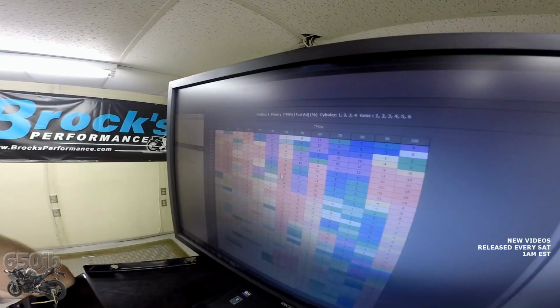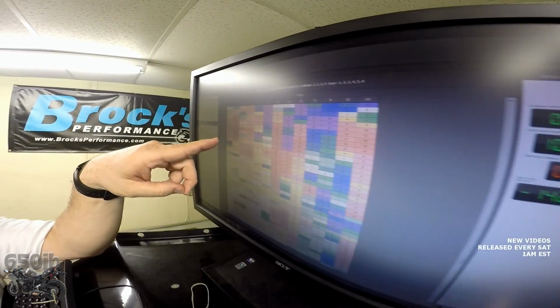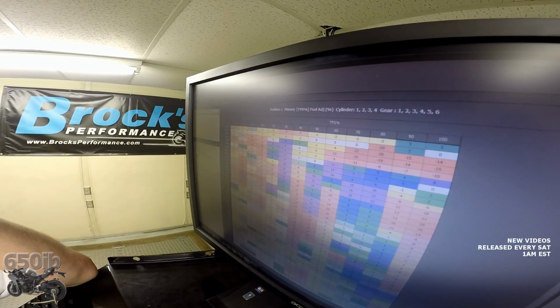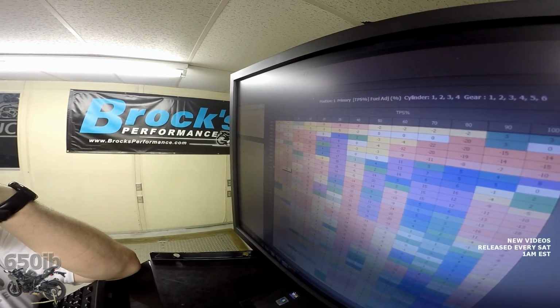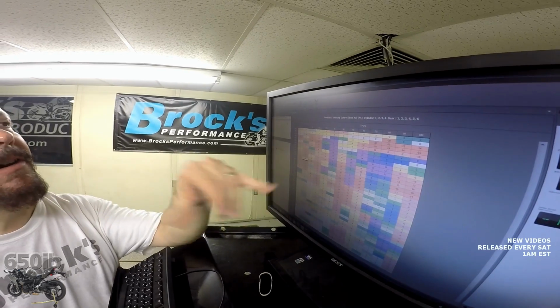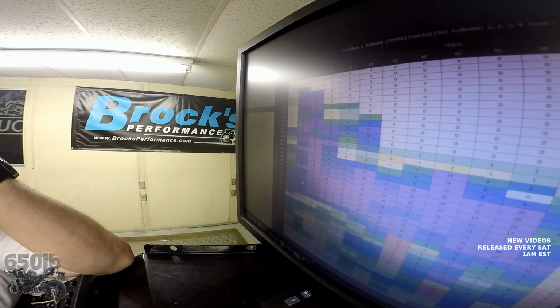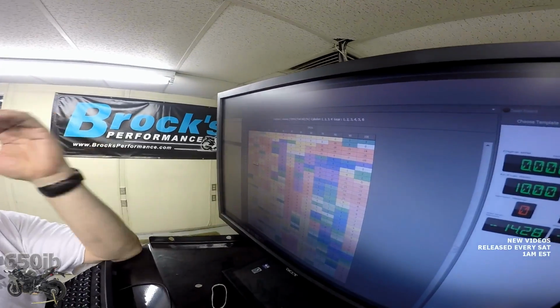Oh, wow. Now, same thing happens. The less fuel that gets pulled away, the lighter the colors, and you actually get into some deeper reds. Look at this, minus 31, and you said one of your problem zones was 4,000 to 6,000. Well, let's just pick, for instance, 2% throttle, 6,200 RPM on your current map. On your old map, 2% throttle, 6,200 RPM, you are adding 7. So I mean, that's an absolutely huge difference. You're looking at 40% difference in fuel, just in that one particular area between what you had and what you needed. So that was going on all through your mapping.